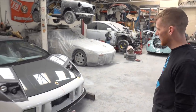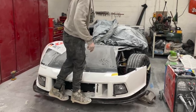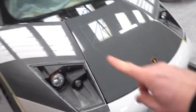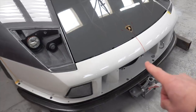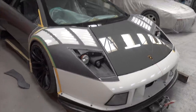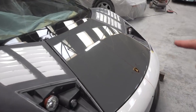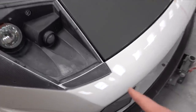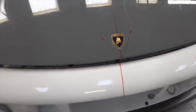We've got a nice picture of the classic demonstration of whether a splitter is mounted securely or not — I'll put that in. Basically even down to things like where the bonnet aperture goes — on the race car it has a big radiator there for the oil cooler and it doesn't have any luggage space. This is a road car, believe it or not, and I wanted to keep that space. So Gaz has had to basically make the aperture for the bonnet seal, which is quite a complicated job, and also involved creating a new slam panel with all the mounting points.